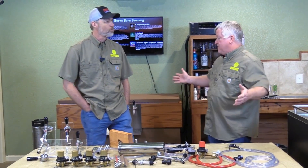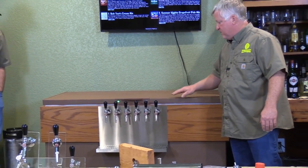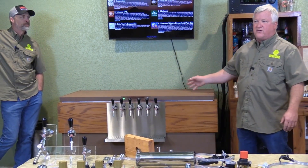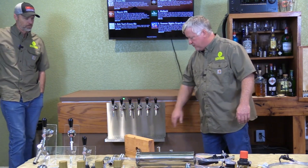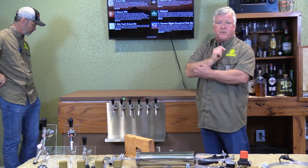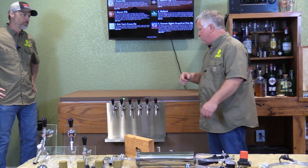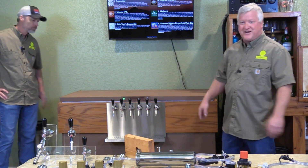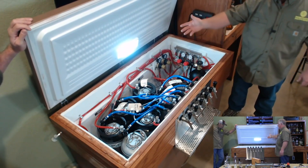We're pretty much done — we've built it. Here's our keezer and we've got the finish that matches, but we also have a lot of other features I want to go through. Over the years of learning about keezers I tried to incorporate as much as I could: we have the flow control V10 faucets, we have the drip tray, the drip tray actually has a line going straight down and I go under the keezer with that and come back out on the side where people don't see it, with a bucket over there collecting the runoff. You don't want to drill a hole going on the inside because you're going to hit a cooling line. I'm going to open the keezer up now and show you how everything's organized. You saw the light come on — we now have two independent plugs: one plug is operating and turning the compressor on and off, and the other plug is turning the light on.